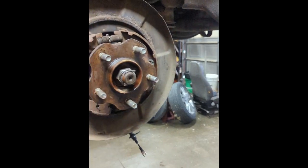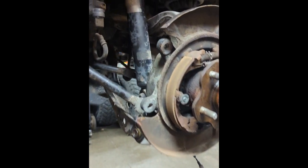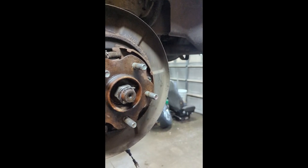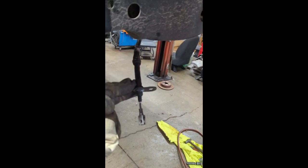The video I watched, the guy was taking apart bearings and all kinds of stuff — you do not need to do that. You'll end up pulling all this stuff off after it's on the ground. Tire off, basically all your brake assembly off. The whole point of taking that off is so you can get the e-brake cable out of the back.